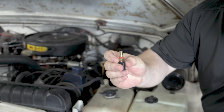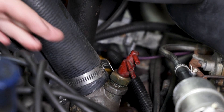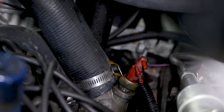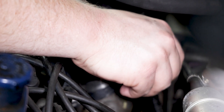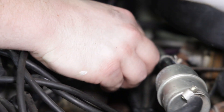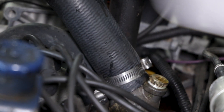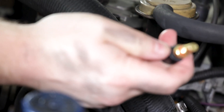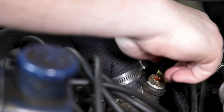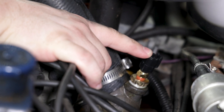First things first, let's figure out where we're going to install our engine coolant temp sensor. On this application, we're going to the factory location on top of the water neck. You may need a reducer like we included in the IC7 standalone kit, that reduces this three-eighths port down to a one-eighth MPT sensor. Be careful — water will probably pour out, along with a little bit of paste. Now that we've got paste on it, we're going to install it back in the engine, feed it in by hand. Now that our three-eighths to one-eighth reducer is installed, let's tighten up our one-eighth inch coolant temp sensor. Slide it in, thread it into the hole, and once we snug that down, we can use the plug-and-play standalone harness to connect right up. Our engine coolant temp sensor is installed.